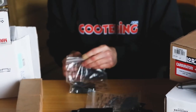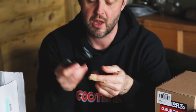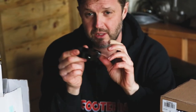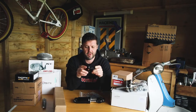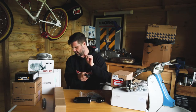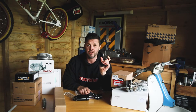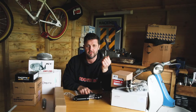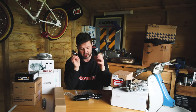Another bit of kit from BGM that I think is really useful are these brackets. If you haven't got the damper bracket on your existing forks, these are a really nice way of adapting your existing fork setup without having to go to the trouble of sanding them down, welding on new brackets, and then having them powder-coated or painted. You can just literally fit these on. Bearing in mind that the majority of the force is going to go through the suspension springs and this is to damp the rebound, these are a really good bit of kit — £55. If you weigh that up against the cost of weldable links, where brackets are cheap but you've got to pay somebody or go to the trouble of scrubbing off your old forks, welding them on, and measuring them to make sure they're at the correct heights once welded in that fixed position, this actually works out as a really, really good financially viable option. And they actually look pretty trick too.